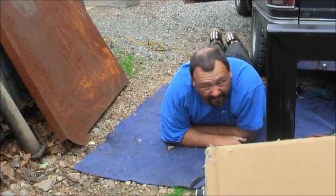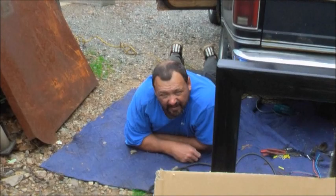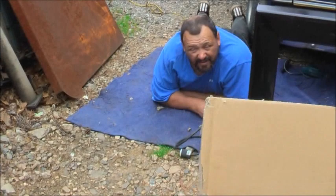She's been around a bit. That is cool. You can't find these spun aluminum ones nowhere. Did you run it on your stuff or mine? It don't matter. He said put it to use. Everything I got is tunnel rammed. I can't run a single. Suburban nosed it over a little bit. Well, we run velocity stacks on everything. 57, everything's got a velocity stack, except the truck. Yeah, truck's got one on right now. You can't tune a carburetor without taking that damn low profile breather off there. It sucks.